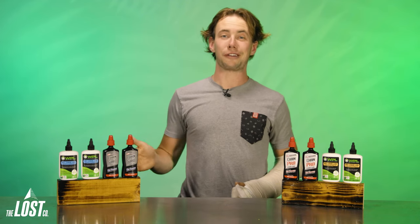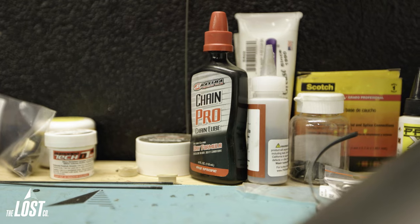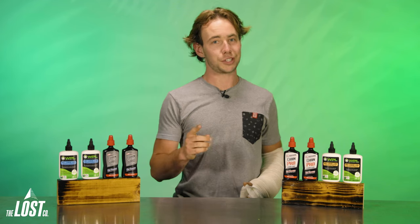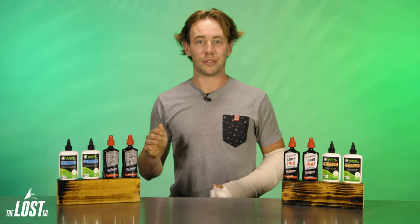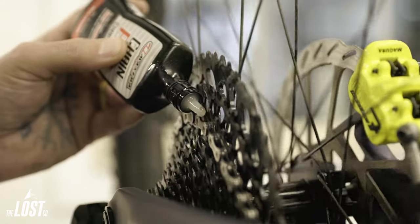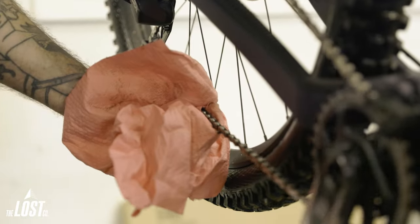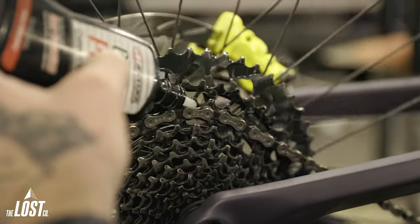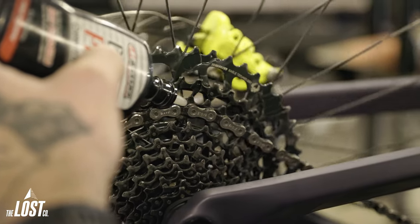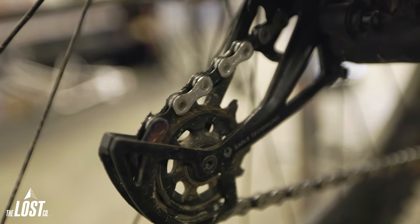So which lube is right for you? If you're riding in dry conditions and really don't expect to run into any random storms or ford any rivers, then dry lube will work great for you. You just need to remember to let it dry for at least a couple hours before getting it all dirty. You can also use wet lube in these conditions as long as you apply an appropriate amount — just a drop of wet lube on every link is plenty — and make sure that you wipe the chain clean after application to get rid of any excess that dirt could stick to. Done correctly, the wet lube gets in between the links and rollers of the chain but isn't on the outside of it, so you can get the best of both worlds with the performance of wet lube without the mess. Careful though — overusing wet lube and letting dirt stick to your chain is what leads to the buildup of crud on your derailleur pulleys, so you've got to stay on top of keeping it clean.